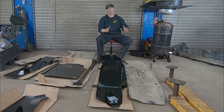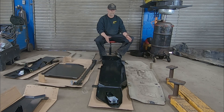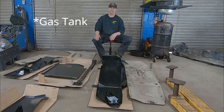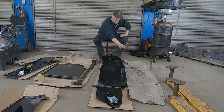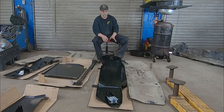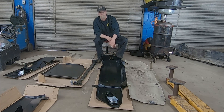This is where the two systems become very, very different. When it comes to the gas tank skid plate, these two companies attack this in a very different manner. Metal Cloak sends a skid plate that goes over top of the stock skid plate system. Rusty's reasoning is: why put the skid plate underneath the factory one and lose extra ground clearance when the stock skid plate isn't really doing anything other than holding the gas tank? So Rusty's ditches the factory plate and sends you their own, which not only acts as a skid plate but also holds your fuel tank — it's all 3/16 steel and designed to bolt right into place.